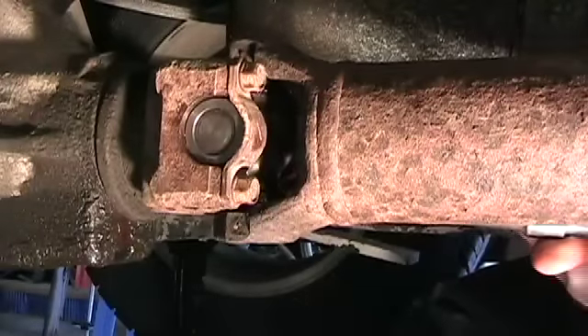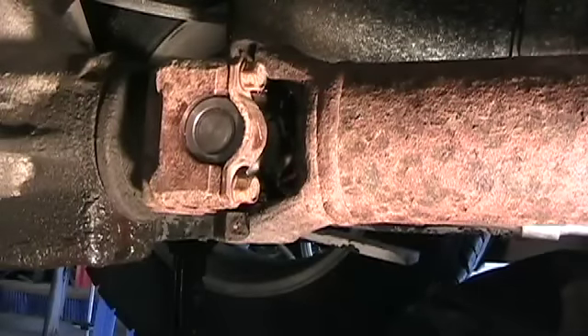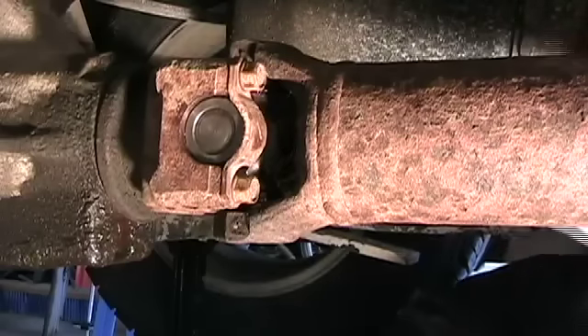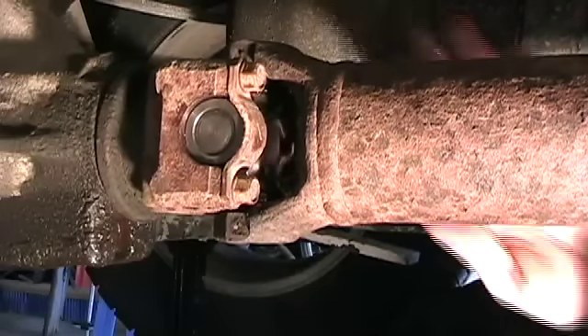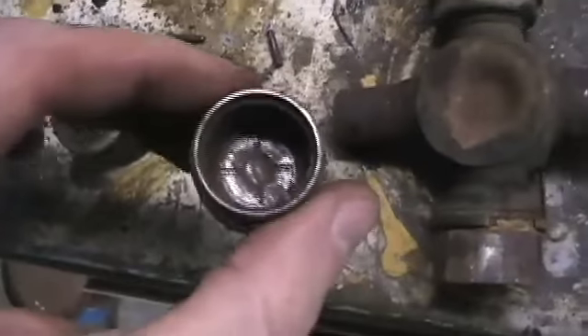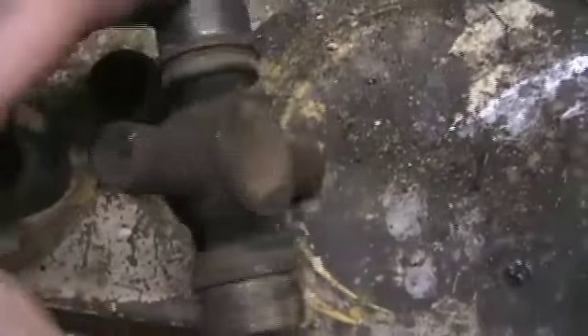And that's it. I just slowly walked the u-joint into the yoke, equally tightening each bolt until it rested against the yoke. That's how you change a u-joint — a rear u-joint on a 1999 Chevy S10. It's not that tough, kind of a pain, and it helps to have some specialty tools. One more note — here's the old one, and these are the needle bearings that are left. The other side didn't even have any — they were just a ball of mush. Even these don't rotate. Definitely a toasted unit. If you have any comments or questions, feel free to leave a comment on the website.